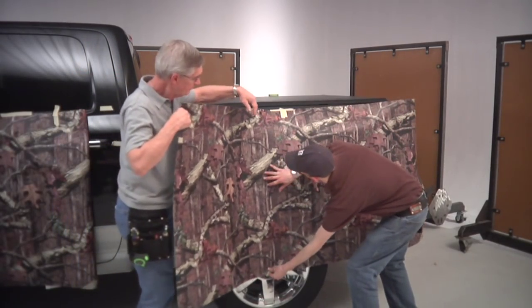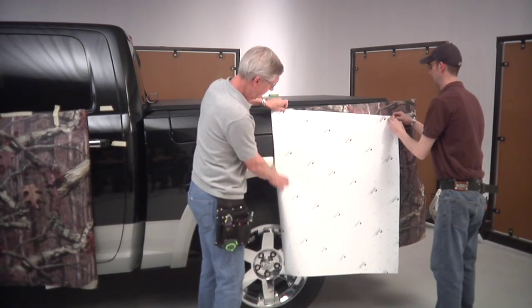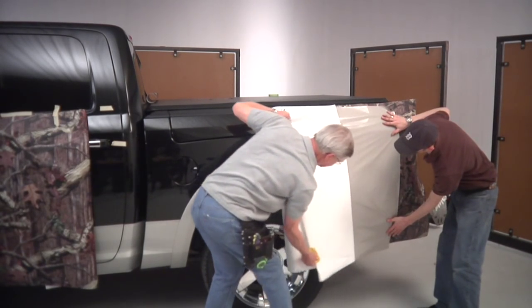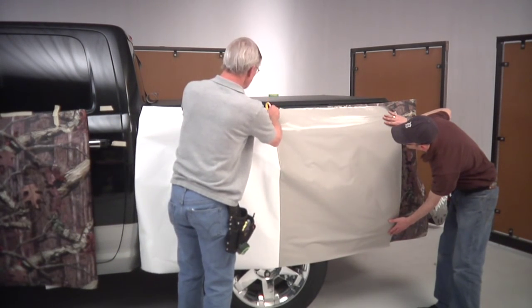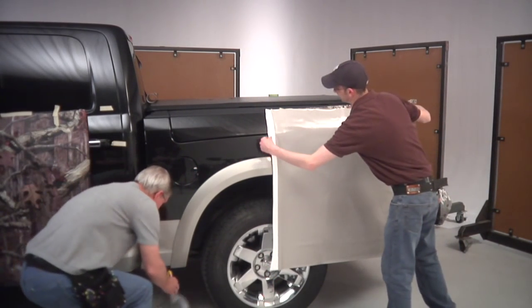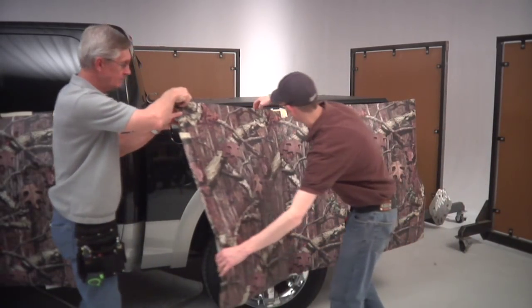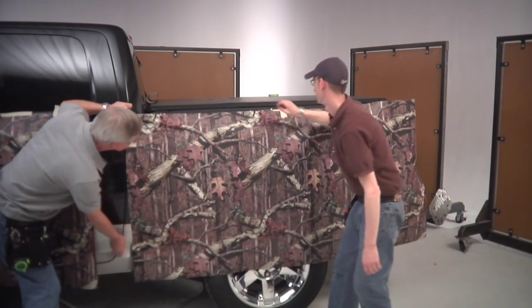What we want to do here is hinge it — the masking tape is the hinge. Reinforce it with three or four pieces of masking tape, pull that piece back, and pull the backing loose. This is a real good time to have a buddy with you — it works really well when you've got a friend to help. Once the backing is pulled off and trimmed, you bring the hinge back around into position and you're ready to put the vinyl on the side of the truck.